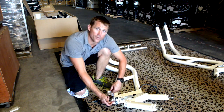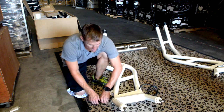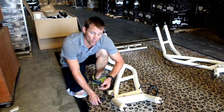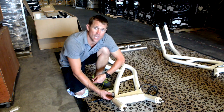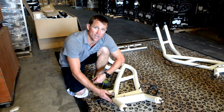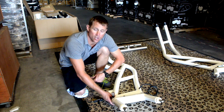Spiking holds the thimble off the tower section just a little bit. Drop the tower foot down and at that point you'll be able to install your bolt. This is necessary if the weight assist system is too tight down inside the tower. Under normal circumstances you might not have to — some towers are nice and tight, so you may want to spike it just to make it a little easier.